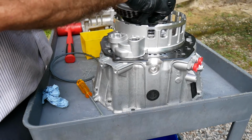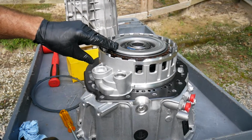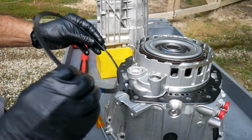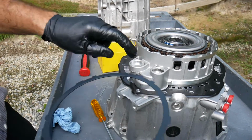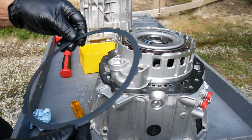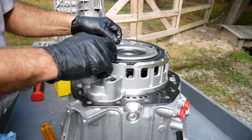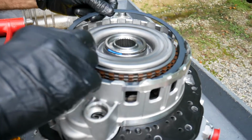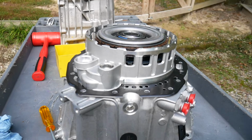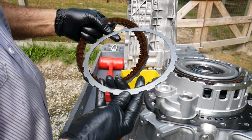Here we're going to set in the clutch that's going to connect the P1 planetary to the turbine shaft. Here we're going to set in the actual cushioning spring for the multiple disc clutch that's the brake for the P1 planetary. Mercedes likes to use a dish type spring, and of course we want the bowl of the dish pointing down. On some of the assemblies there's an uneven spacing, so there's only one way or a couple of ways that the spring will move into position, and here we see the corresponding clutch stack. Obviously a steel is always going to go against the spring.